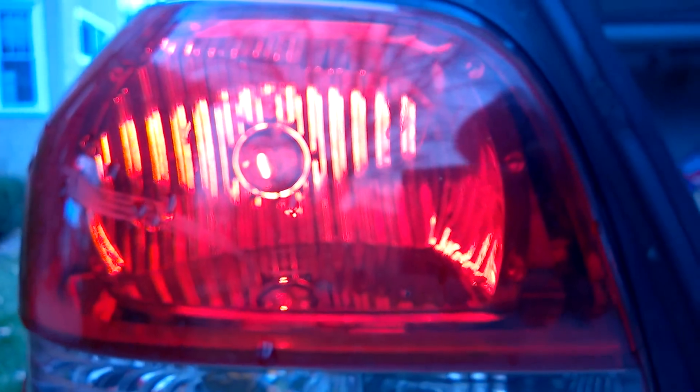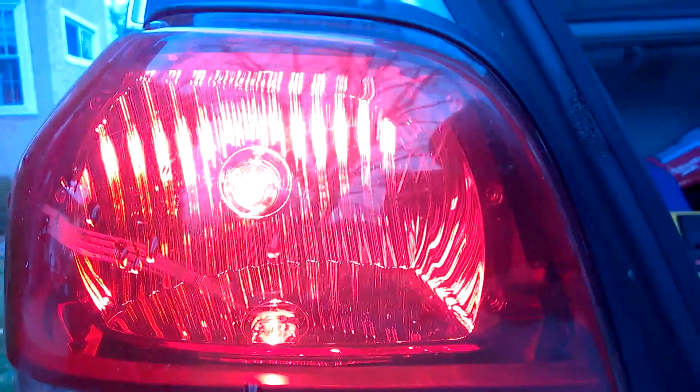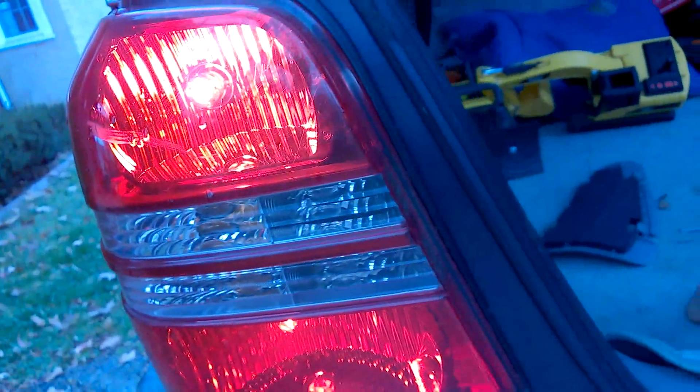From there it's traced out throughout the whole light. Now I'm going to take that wire and just jiggle it, and you'll see what happens to the brake lights. See that? I gave them a jiggle and now they're both working. So there's something in this connector.